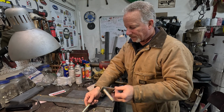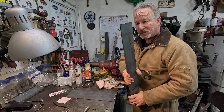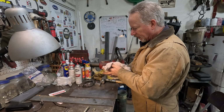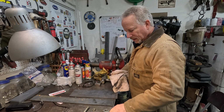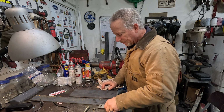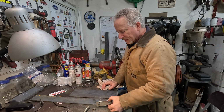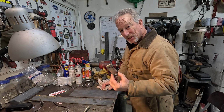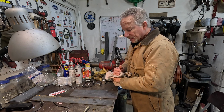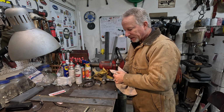So, there we go. So now the plan is, I don't need to use this. Just this one. Now I could, thinking about this, okay, I could use this plate, split it right down the middle, and make the shackle adjustable. I can put another hole, 2 holes in it, so that it's adjustable for even longer if I think I need it longer.